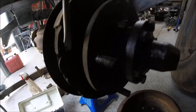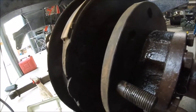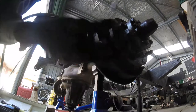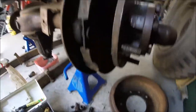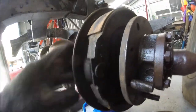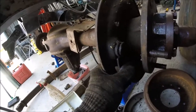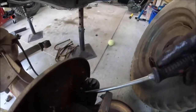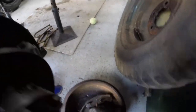There's a lock tab that runs across the two of these, so obviously we've got to flatten them before we can take the bolts off. That's what it looks like with the lock washer. Now that's free to come out of the little recess area - just prise that out. That's the top one, and the bottom one has a spring on that side. Something with a screwdriver can generally pop those out. That's the long one on that side which joins on.